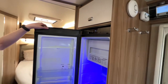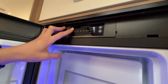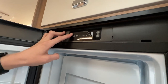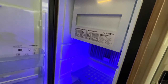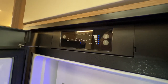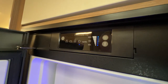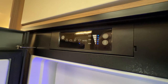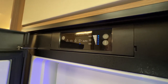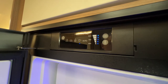To operate your Dometic fridge, open the door — the control panel's on top, it's a flush control panel. Press and hold to turn it on and off. You've got three sources: mains hook-up when hooked up — like a household fridge; gas, used when wild camping; and battery, which feeds off the engine when it's running, designed for travelling to keep your shopping fresh. You have to pre-chill the fridge beforehand on either gas or electric — putting it on the battery setting with warm shopping won't get it cold. Or if you're moving from one site to another, it will keep your shopping fresh.